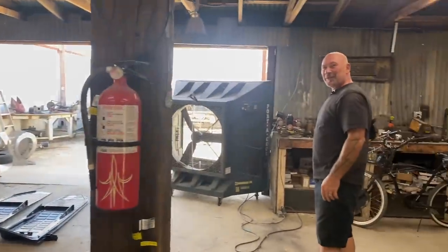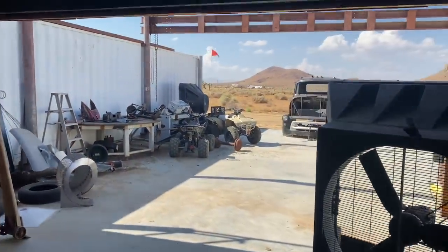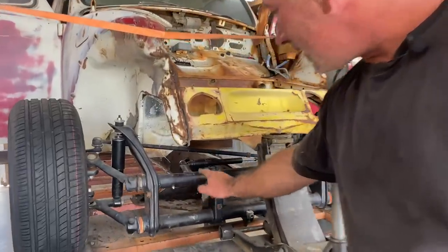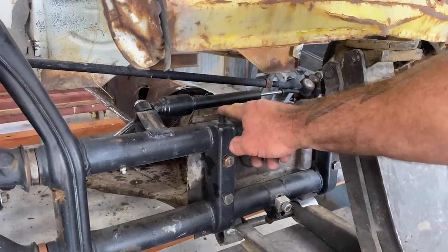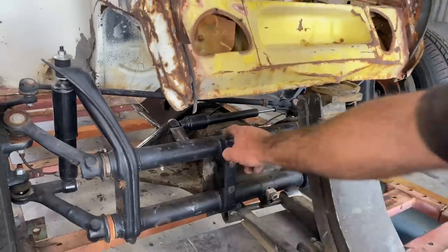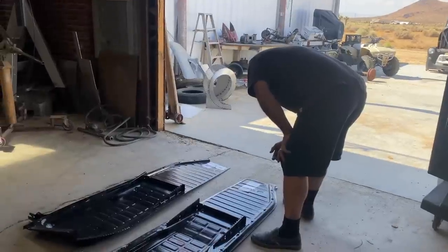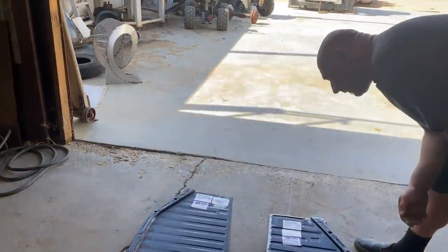That was a mouthful - now that we've got all that cleared up, look at that body. It's in great shape now that it's lifted up. So about the Volkswagen - pretty good shape all in all. One thing I noticed when putting it on with the floor pan: the way that we notched this to increase the caster, I immediately saw that raising it really interferes. We're gonna have to cut these little mounting tabs off and remake them because now they're a little bit rearward and hitting the mounting points - so when we drop it, remind me we gotta cut those off. Other than that it fits. The way we install this: first pick it up off the floor and don't cut yourself. These are actually made in Brazil, so I bet they're a direct fit.